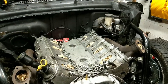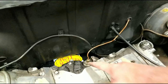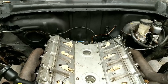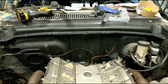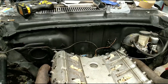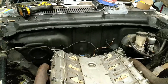About to put the intake on. I actually remembered to do my oil pressure sender. I run mechanical gauges in the car also, so I have backups — if my computer's ever wonky or my screen, because I have a tablet in there for the gauge screen for the micro squirt. But if that ever goes or the battery's ever dead, I like having some mechanicals. So I run oil pressure and temperature mechanical gauges also, just as a backup.